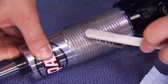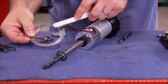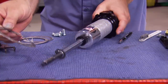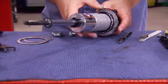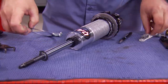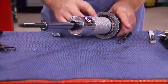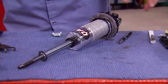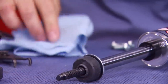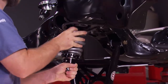We're using a nickel-based anti-seize here rather than copper-based — it blends in with the shock body and looks a lot nicer. We're also going to put anti-seize on the thrust washer. Rather than just using the thrust washer and putting the spring on top, we're using a thrust bearing as well. So the thrust washer goes on first, then the thrust bearing, then we anti-seize the other thrust washer, and that's where your spring sits. The shock gets its upper mount bushing, and after we slide on the spring, the assembly slips into the stock location and gets attached to the frame with the bushing and nut.